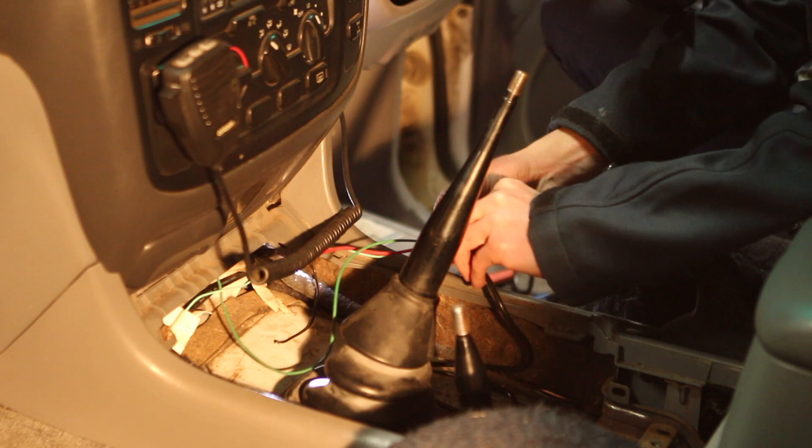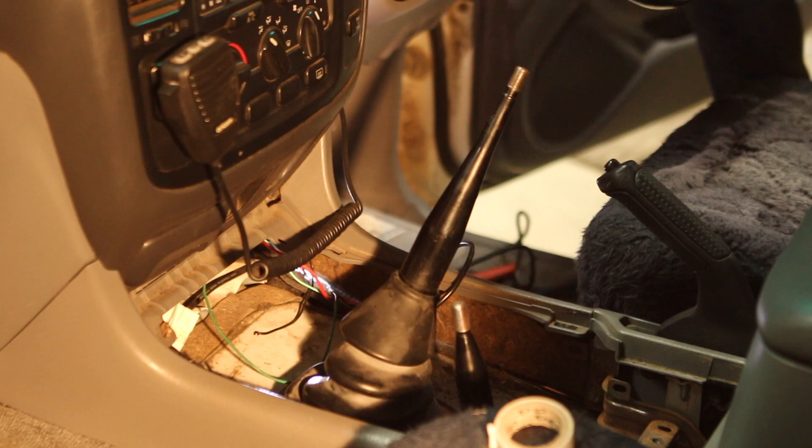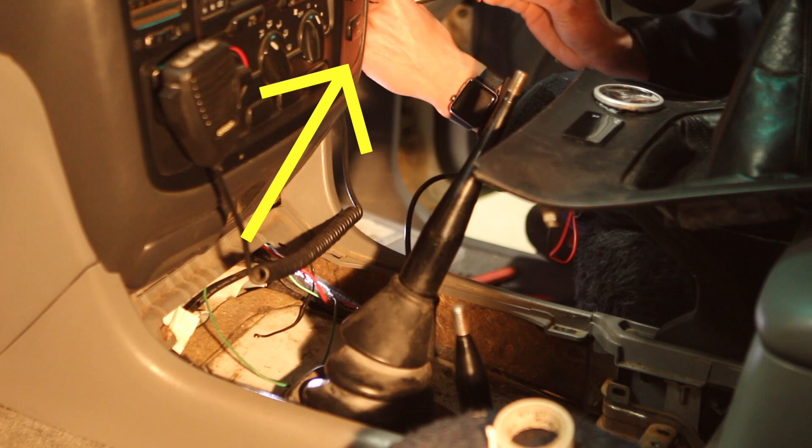I'm wiring what for me is the yellow dash wire backlight up to a separate switch that always has constant battery power to it, so that I can choose to dim or brighten the backlights of these gauges whenever I like.